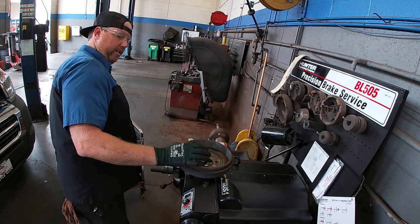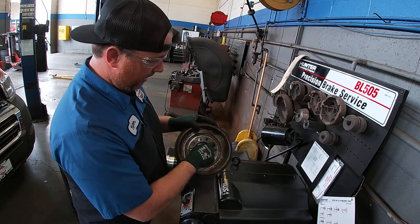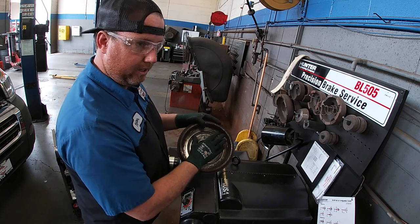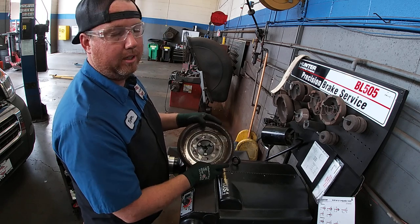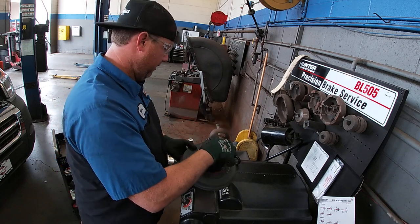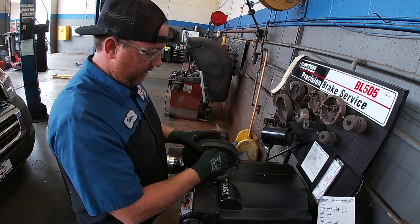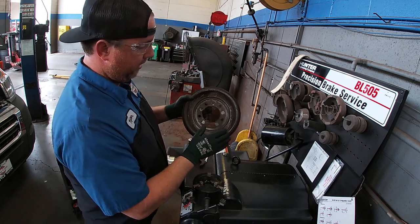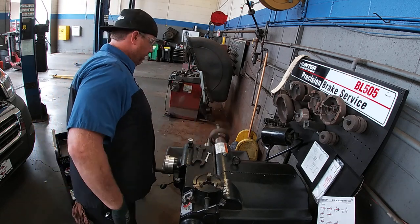Treat the drum just like a disc — spray it down with brake clean. Also take any rust off the hub-facing surface. If you have rust buildup between the drum and the axle hub or wheel bearing hub, you run the risk of it not going on flush and the wheel becoming loose over time. Make sure to clean all the rust off that surface and the wheel face — that's one of the key steps to ensuring your wheel is on tight. With the chuck off, clean it up with a little brake clean, replace the brake shoes, and you're good to go. Thanks for watching — we'll see you in the next video.